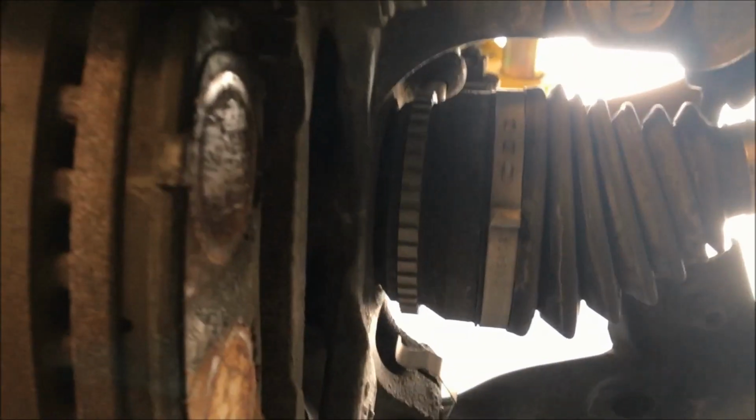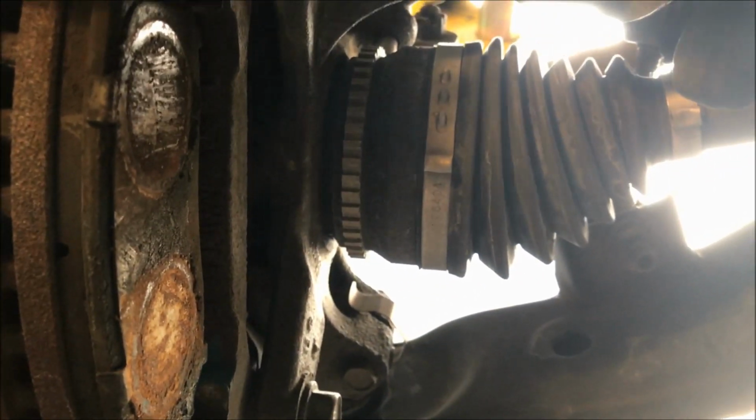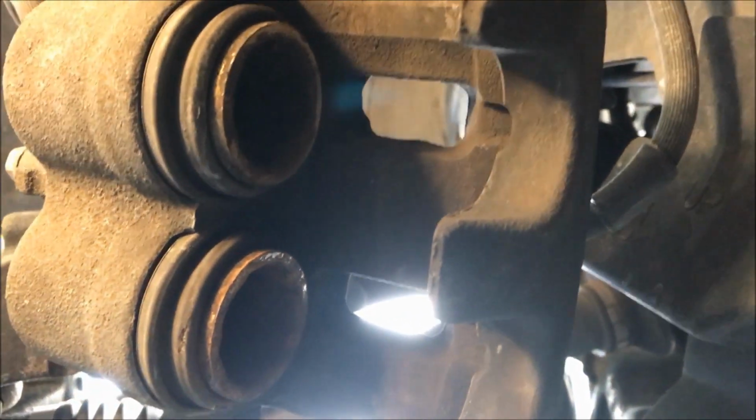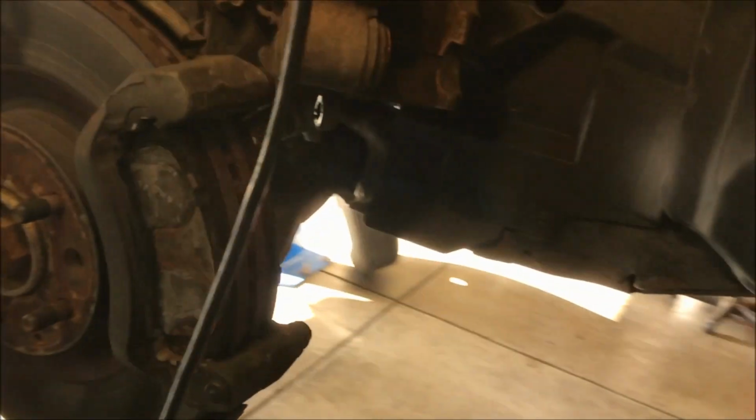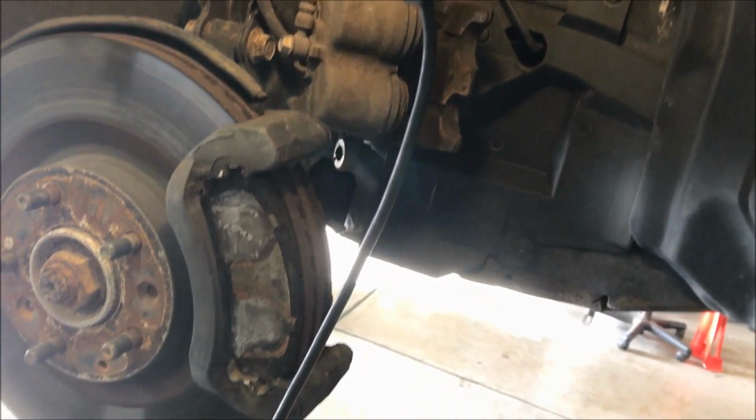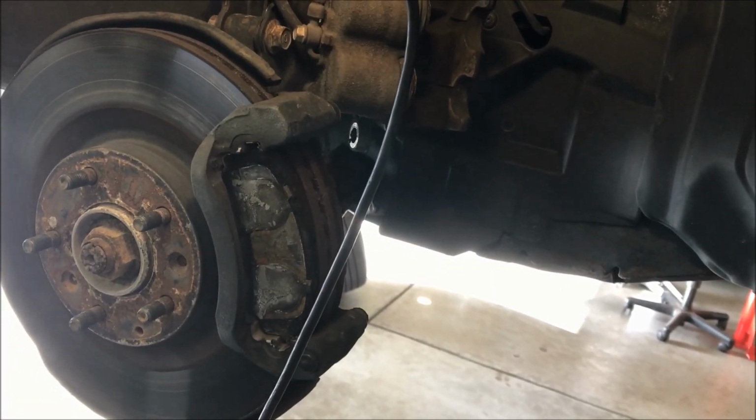And then on the back side where the pistons touch, you can see those two circles is where the two pistons contact. So it's those few spots that we're going to focus on greasing up to keep it from squeaking.